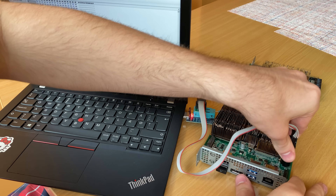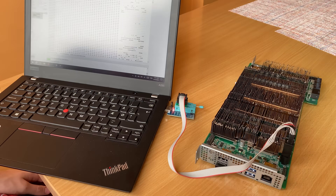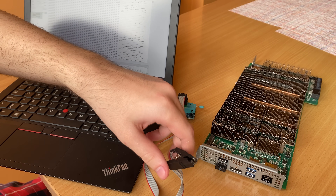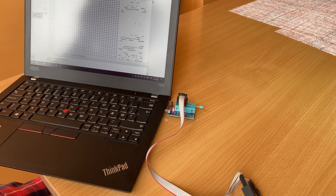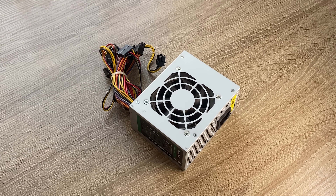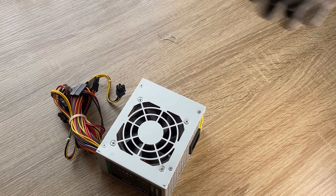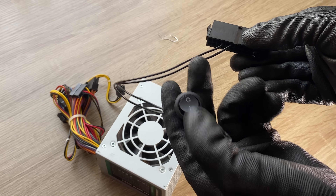I myself got one of those unlucky boards. All I needed was to flash a modified BIOS, which allows me to choose the allocation I want. For this, you will need a programmer and some knowledge. If you have a Raspberry Pi, you can use it as a programmer. The power supply will not turn on its own, so you need to help it either with a PIN shorting or with a Chinese switcher.